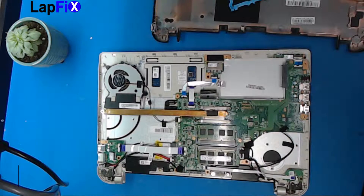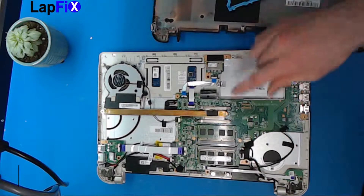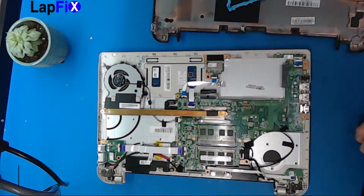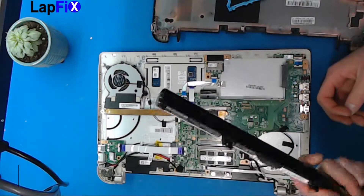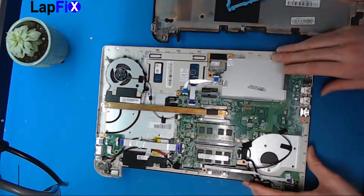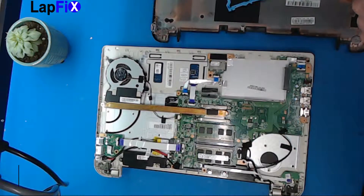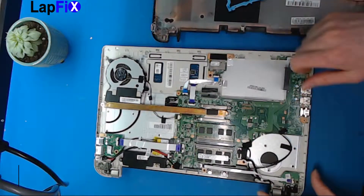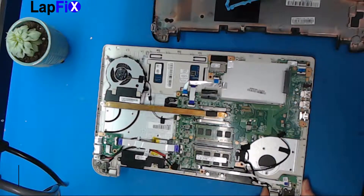So that's a quick teardown of this Toshiba laptop and how to remove the hard drive. We can see the RAM is replaceable too — it's pretty straightforward, just pop up the back, really. The first thing you want to do is remove the battery, but other than that it's pretty straightforward — it just has a back cover. Some laptops get really complicated where you have to pop the keyboard out first and unlatch everything else, but this one's pretty straightforward.